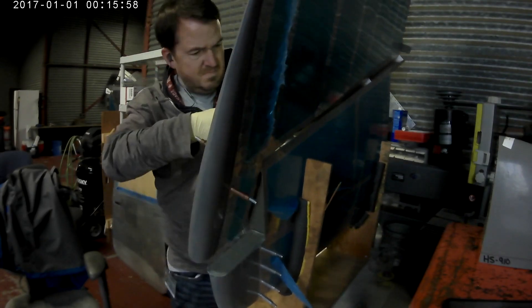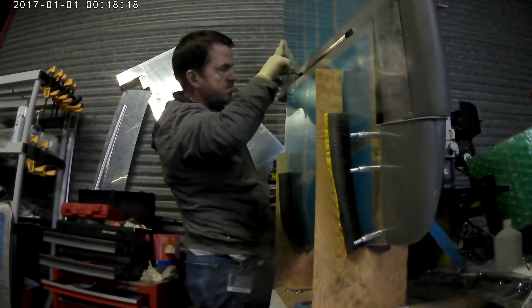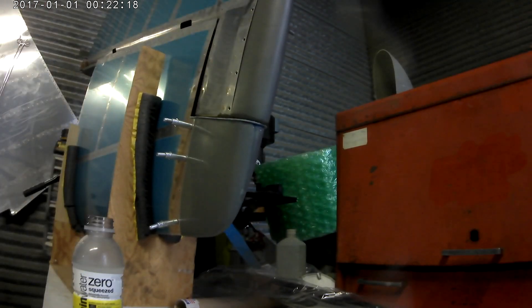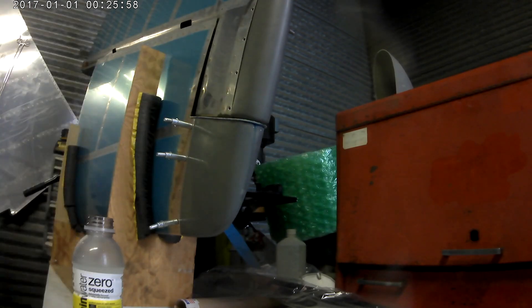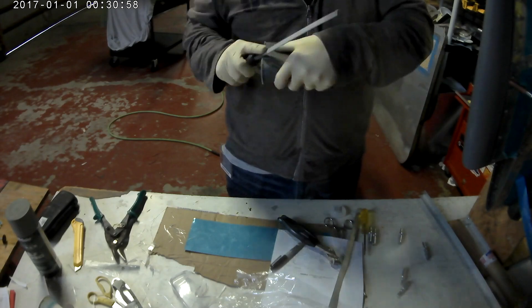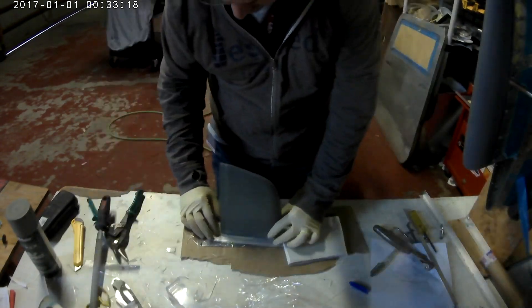Now that it's made, we're putting the rudder back on — which is a pain — and checking the height. I made this really tight: it's about a sixteenth of an inch between the rudder and the fairing. There's absolutely no contact — that's the nice part. If you push, you can't make it even come close to sticking. Van's spec says an eighth of an inch; I've made a sixteenth. Here's a picture of the fairing connection between the two — very tight, but there's no contact.